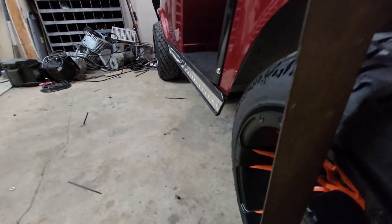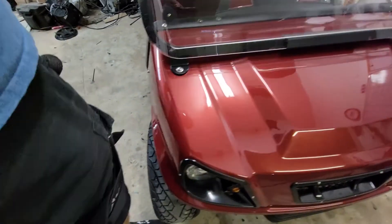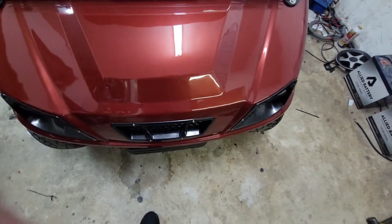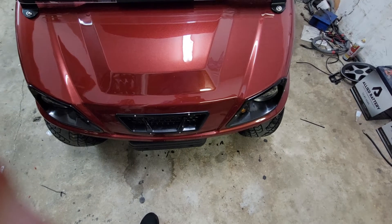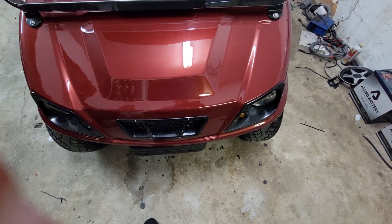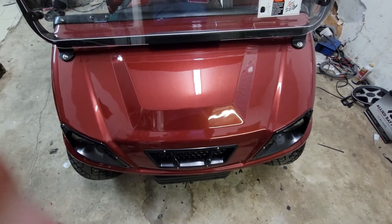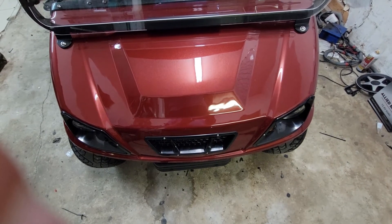On the other side we're touching at the top and have a little gap at the bottom. This particular model has an eccentric bolt right in the center of the leaf spring. We're going to loosen the jam nut and turn that eccentric bolt until we have the exact same spacing top and bottom on our square. To do that you have to loosen the four spring mount bolts that hold the leaf spring block in place.